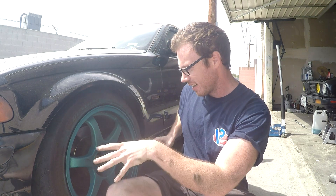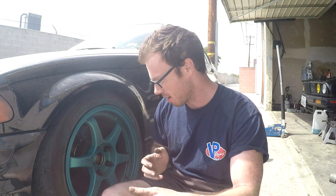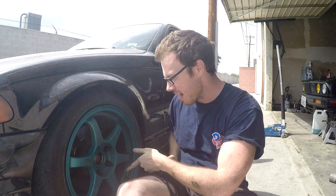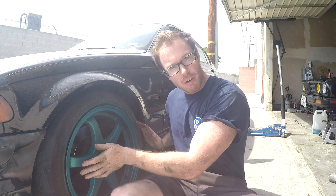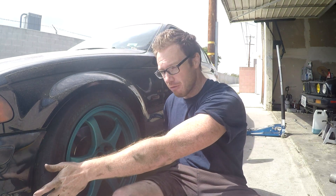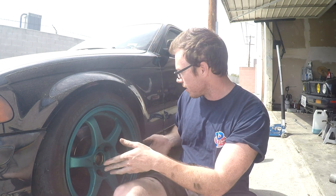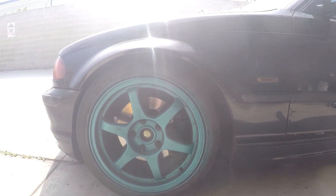All right guys, so the install is done. I want you to take a look at the front wheels of the E46. Here's your imaginary center line — imagine the wheel opening either side even, so it's straight from the middle of the fender down. See how far forward the wheel is pushed on the E46. Now after installing the offset control arm bushings — obviously every car has caster in stock, but not nearly this much. This is a massive gain in front-end caster and hopefully front-end grip.